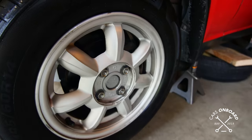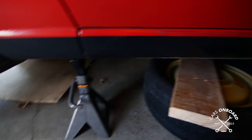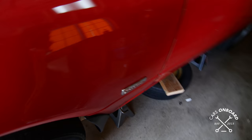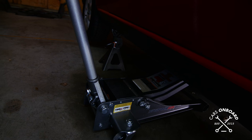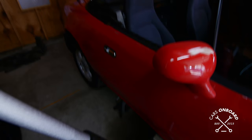The last trick I want to show you: I have my car jacked up on all corners with jack stands. I'm debating on painting my rims to a graphite gray gunmetal — I've done it before on my '90 and it looks pretty good. These are Harbor Freight jack stands; we used them on the Evil 9 project. I also put a tire under the car just in case the stands give out — I don't get smashed. Safety first: it's right against the floor board, so if the car did fall it would probably slow it down and give me time to escape.